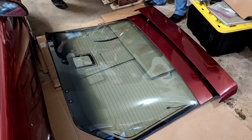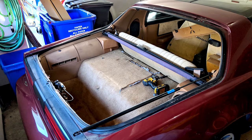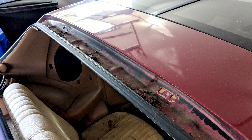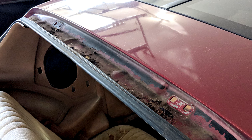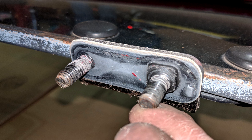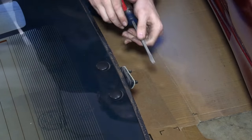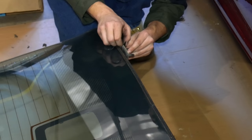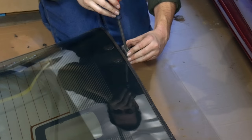We were able to carry it away and set it on the ground very carefully. Here's the back of the car without the rear hatch — it kind of has a bit of an El Camino thing going on. There are three square holes and one round hole where the hatch mounts to the body, which means the left and right side hinges can only be installed one way and there's no provision for adjustment on this side of the hinges. Each hinge has a gasket that seals against the body. These gaskets were pretty dried out and very stuck — it took some work with a razor blade and prying with a screwdriver to get them off intact. We don't have replacements, so we'll have to cut our own, and separating one intact will make this easier. We repeated the same process with the driver's side hinge and were able to get that gasket off mostly intact as well.